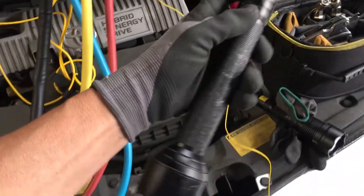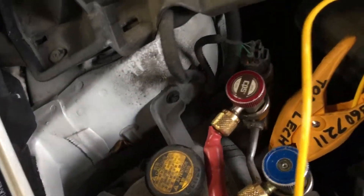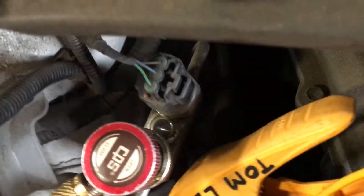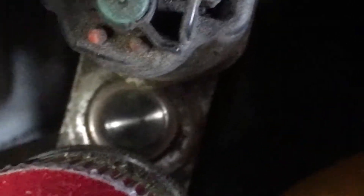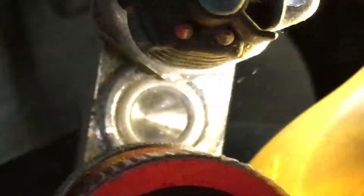The fitting is wet around it, and I'll zero in on it with the electronic leak detector to find out exactly where the spot is. Let's start it up and look at the sight glass — that's what it looks like. There's nothing juggling around in there, so let's go start this thing up. I was also looking for leaks under the dash.